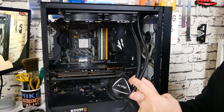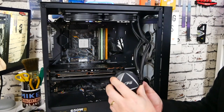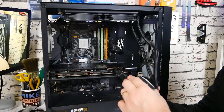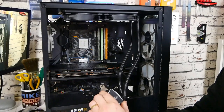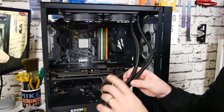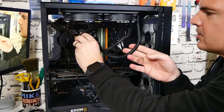The next step is installing the CPU pump fan header. You put the retention bracket in slightly offset and then twist it round into position — a very common design. Line up with the XPG logo facing correctly, put the bracket on slightly rotated, pop it on the back, and twist it to lock. There's a little lug at the top to confirm it's locked in position. Then put the pump onto the standoff screws — no paste needed as it's already pre-applied.